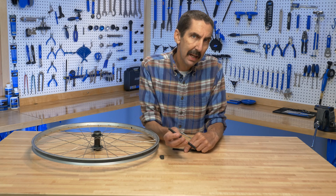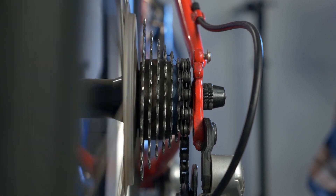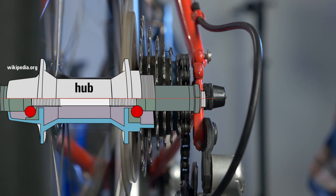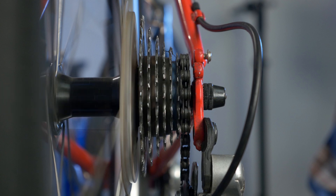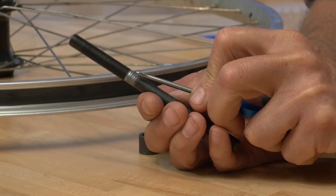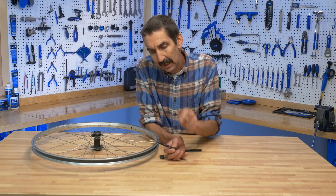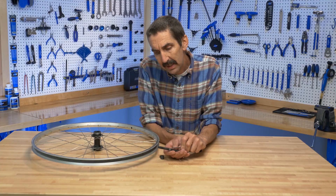So this axle is not bent. It's clearly got some damage here. There was a problem. The problem was in the last assembly of the hub. Jumbled ball bearings out of place caused the hub to be eccentric around the axle. A hub ball bearing down inside the shell is causing these gouge marks — that's what caused the eccentricity.